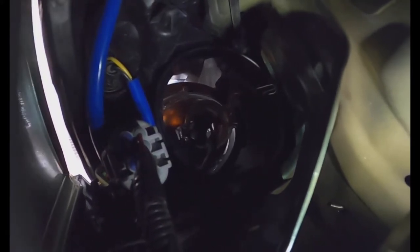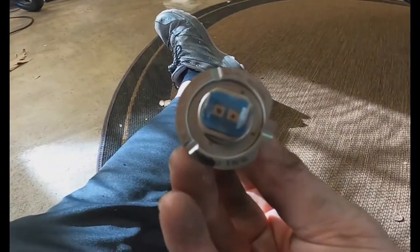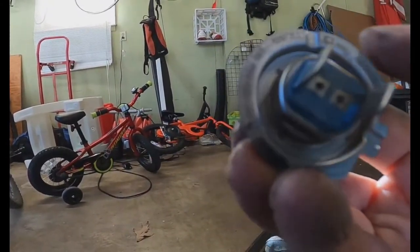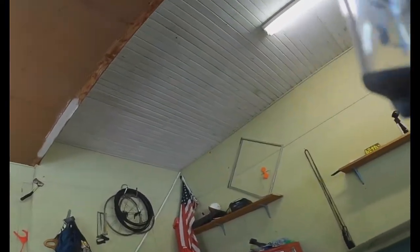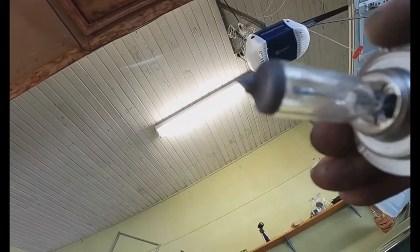The light is out - you can see the wire bracket and the plug I pulled out. There are a lot of wires in the way but it was quite easy. The little wire door opens - it was on the left, holding the light in there. You just push it down and it swings out of the way. Make sure that's cleared because we don't want to touch the new bulb. This is the old bulb - it was oriented about like this. It doesn't look like it's blown... it was not working though, so I hope I pulled the right one out.